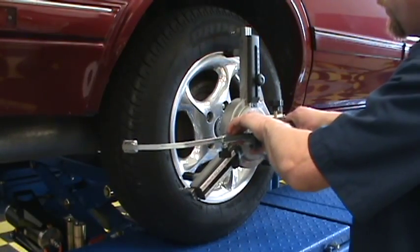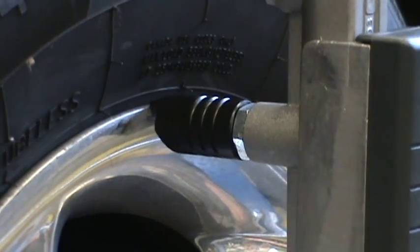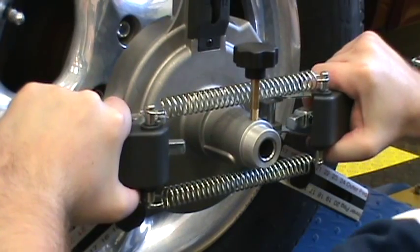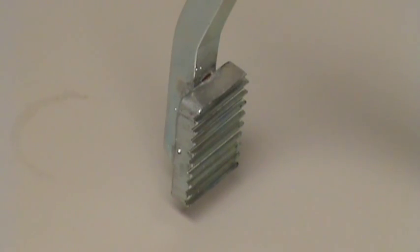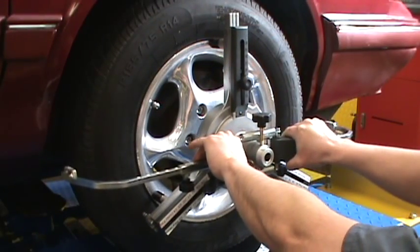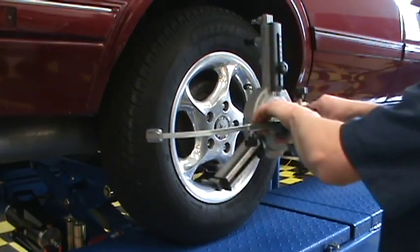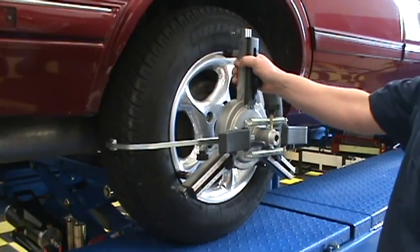Installing an Atlas Fast Clamp is a simple one step process. There are no sharp metal edges that could scratch the edge of a wheel. The spring actuated clamp arms are controlled at the center of the Fast Clamp. The clamp arm has a serrated surface at the end of the arm which grips the tire tread and holds the clamp in the proper position. The operator simply depresses the spring operated clamp ears to extend the diameter of the clamp arms, places the Fast Clamp over the center of the wheel, and releases the clamp ears to attach the clamp securely to the wheel.